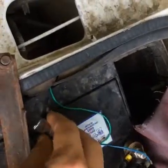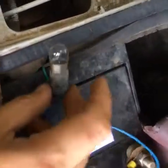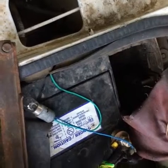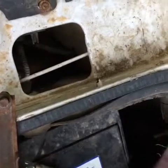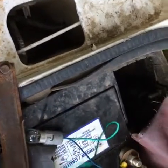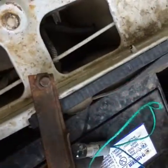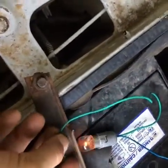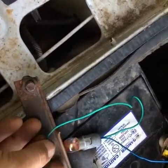Let me try and tighten that up a bit more. I just wanted to introduce you to a little piece of kit that I like and made. Basically, it's a light bulb with a light bulb holder and two cables coming out of it — a simple piece of kit for doing testing. I've connected it straight up to the positive — the blue cable's in the positive — and then the earth wire. Just touch it on this battery holder here, and you've got your tester.